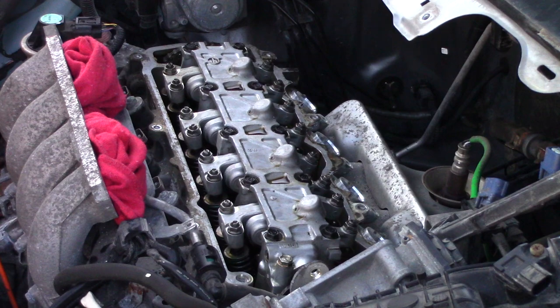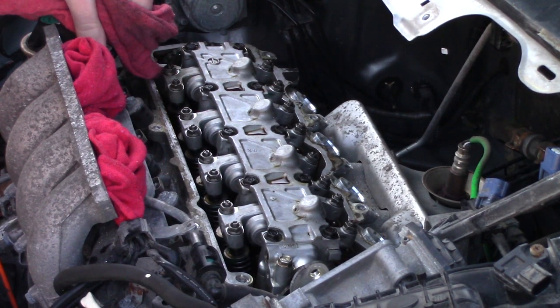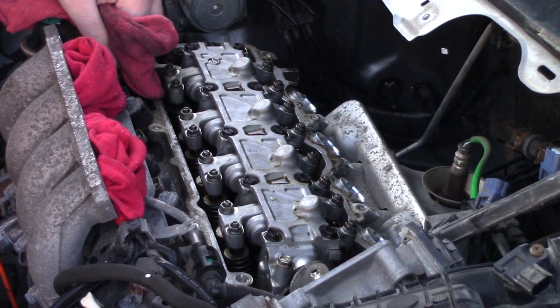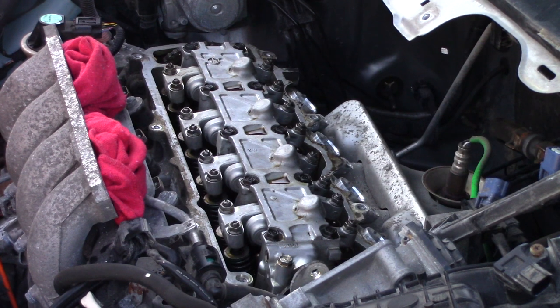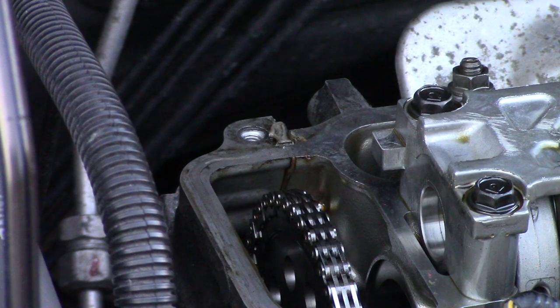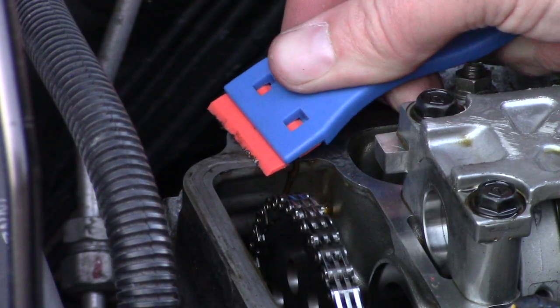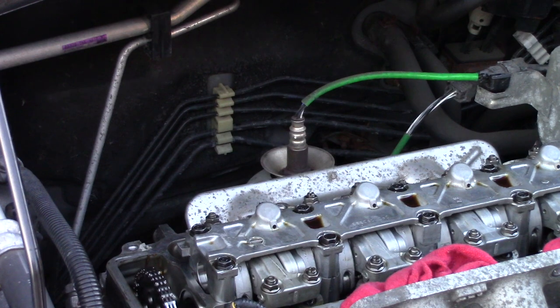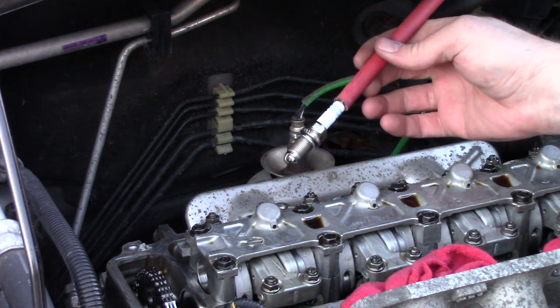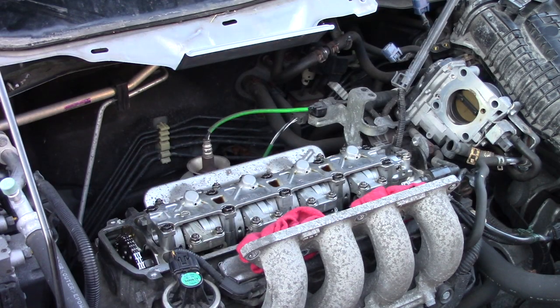Now with all the valves adjusted, you want to get the valve cover back on. First make sure the surface is all clean — wipe away from the oil galleries so that any surface dust falls outside rather than in. In addition to using a shop rag, you might also want to use a plastic razor to help with stuck-on RTV, to get that surface nice and clean. It's soft and safe on the aluminum of the cylinder head. Now I'm going to use this time to get the spark plugs back into the car — I'll use a small piece of hose to hold each plug so I can hand-tighten them as they go back in. Then we're going to tighten all those spark plugs to 20 foot-pounds.